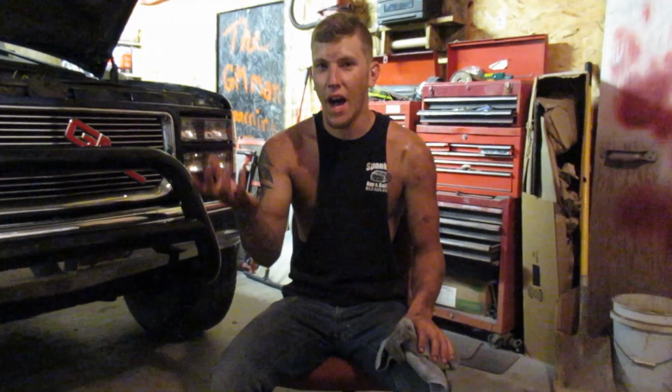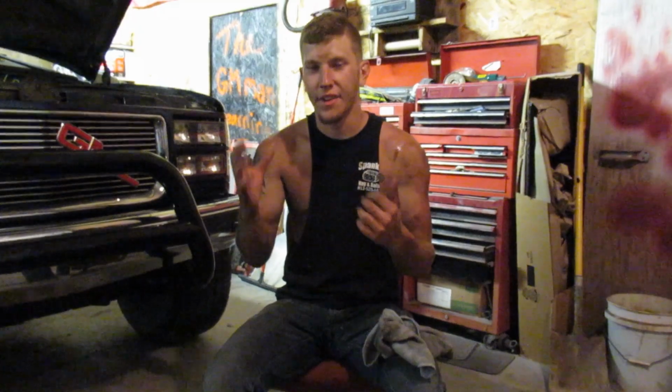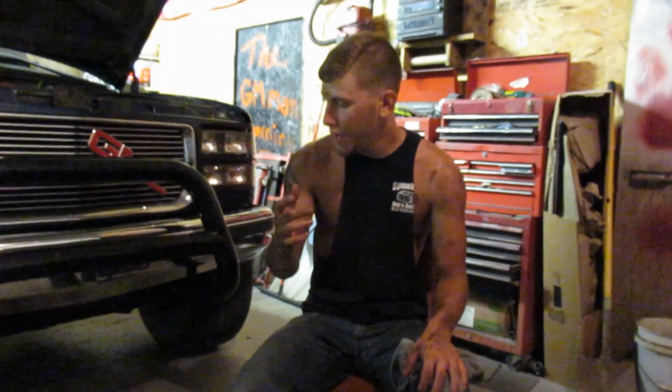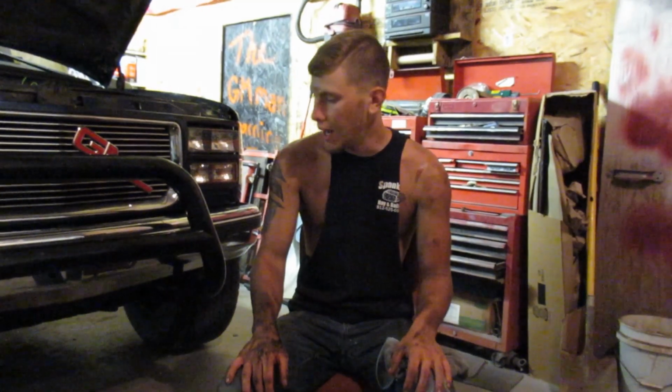Still didn't get it out, so finally I had to take basically the shroud, the piece that covers the flywheel, unbolt the exhaust collector, pull the exhaust collector down and try and pull that piece down, got it out of the way, and still the pan wouldn't drop out because of the transfer case being in the way. So we decided just to put everything back together, put the old oil back in it. We started it for probably 15-20 seconds, made sure there's no leaks. I climbed underneath and it's still dripping from that front oil pan gasket seal there.